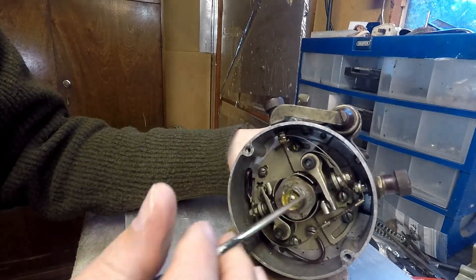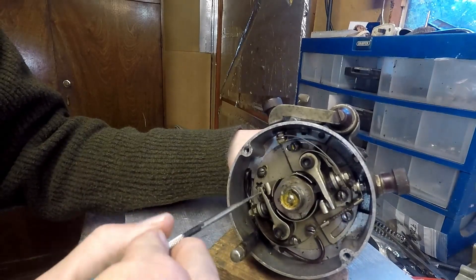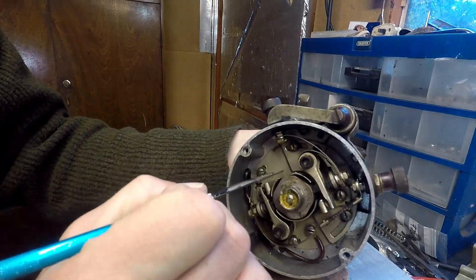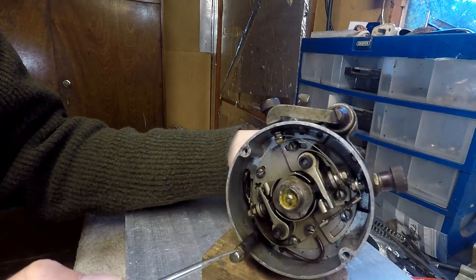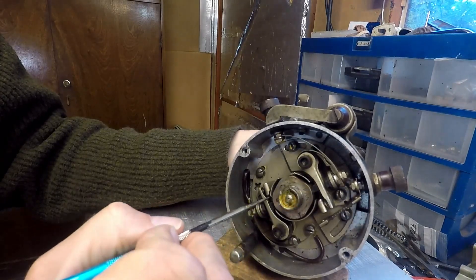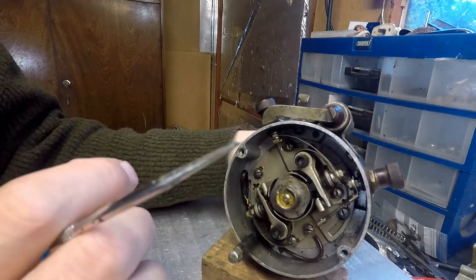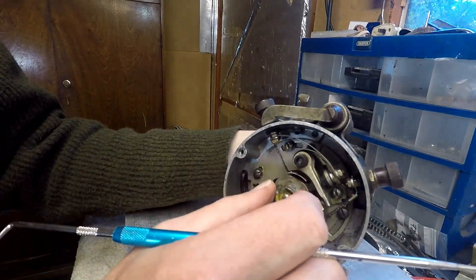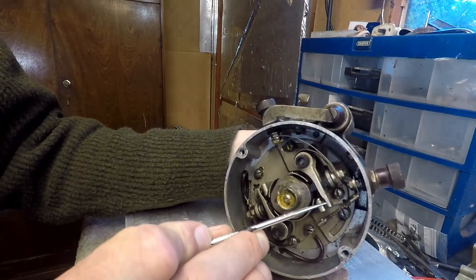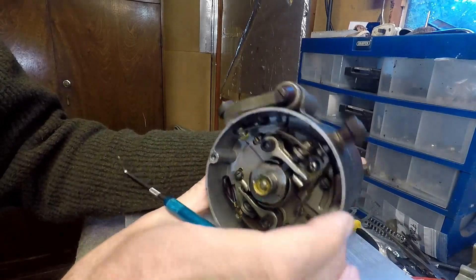The rationale for having a double trigger is that the coil has more time to get energized. If you had a single point distributor, you'd be wasting some degrees, which you can finesse with this dual point arrangement. That's the reason why it's a dual mag.